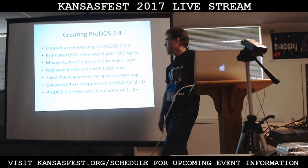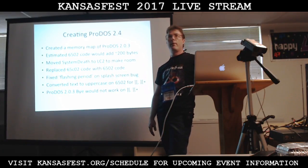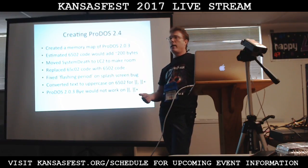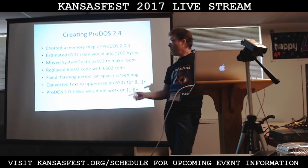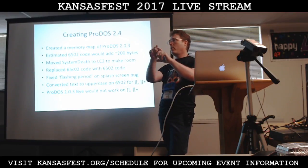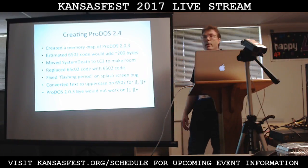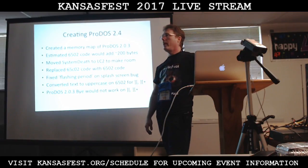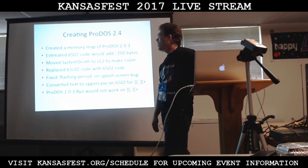So I took a system death function, which probably almost no one has ever seen. It only happens if there's a bug in ProDOS, so I'm sure Apple saw it a lot when they were developing it, or it happens if there's an interrupt that there's no interrupt handler for. Which again, most people don't have a lot of that going on in their Apple IIs. So if one of those two events happens, a little box comes up in the middle of your text screen and says system error, with a number. But again, a bunch of code almost never gets used, but gets loaded every time you run anything on your Apple II. So that's always nice. And so I moved that out to language card 2, so I could make 6502 ProDOS and make it work everywhere. So I did that.